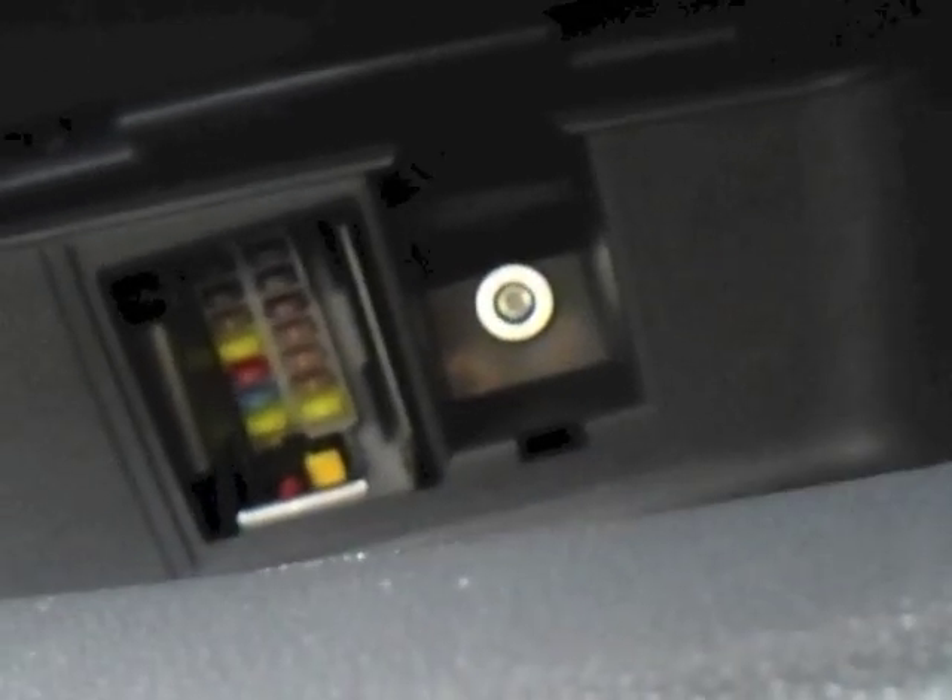Coming down to what I'd call the poor excuse for a glove box — there's a long bolt in there that needs to come out. I've already taken the ones out underneath. I think there's one just here, and then underneath the flap where the little hidden pocket for documents is, I believe there are a couple in there as well. If you forget one — which I have done in the past because I couldn't find it — you end up breaking the box. It's not the end of the world because it's just one screw, but if you can avoid breaking any screws, so much better. That was the little one there that I'd forgotten about in the past — that's when I broke it. So you can see it's come out now.